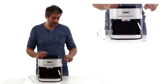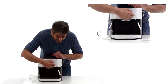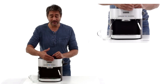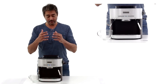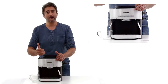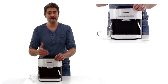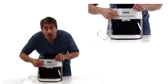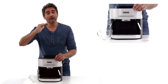After you are done with steam generation, bring the lever back to the neutral position and the steam will stop. Release the button to come back to the standby position. You will see two buttons blinking, which means the temperature of the boiler is dropping. Once all four lights are steady, it is back in the standby position. If you want to speed up this process, press the hot water button and release some hot water so that fresh water comes into the boiler and the temperature drops quickly.